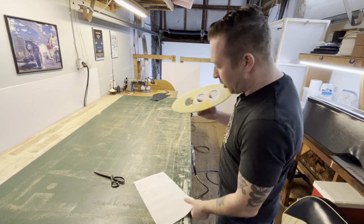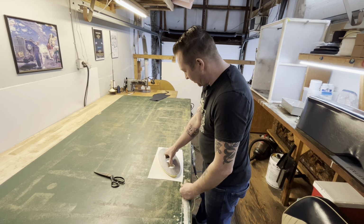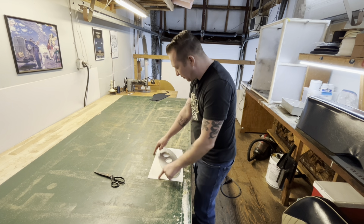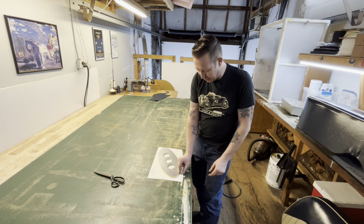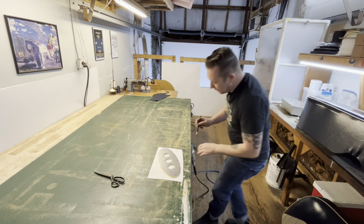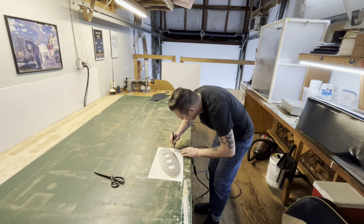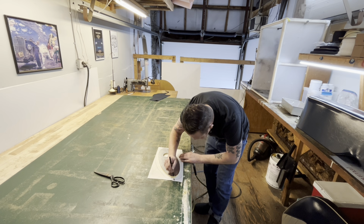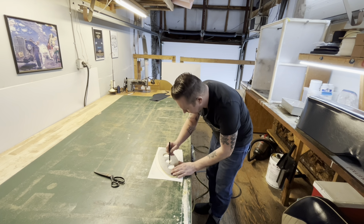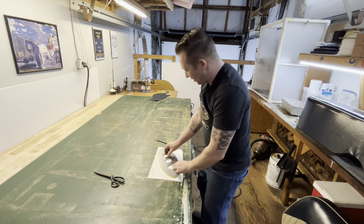Now that we've got our foam work done, we can take our piece of vinyl and we're gonna lay it flat on the table. Drop this guy in place, like so. I'll probably trim some of this excess off, if we had about that big all the way around. In fact, let's grab a grease pencil here and we'll just do that right now. Probably about that big. If you leave too much on there and start wrapping it, it just gets way too bulky. Put some gauge holes in there just so we've got a reference of where to set it.